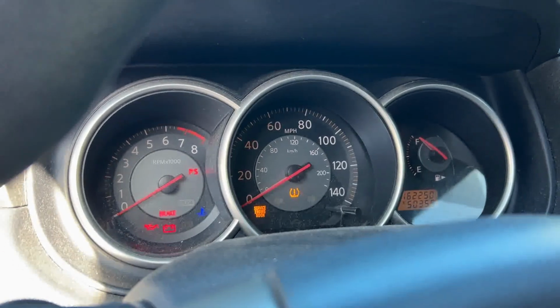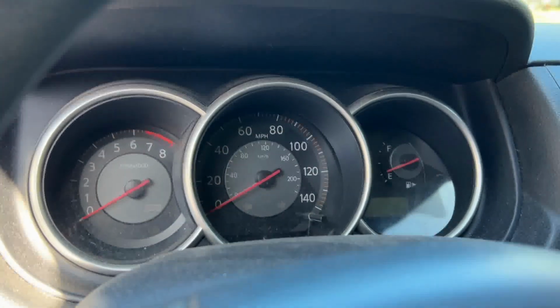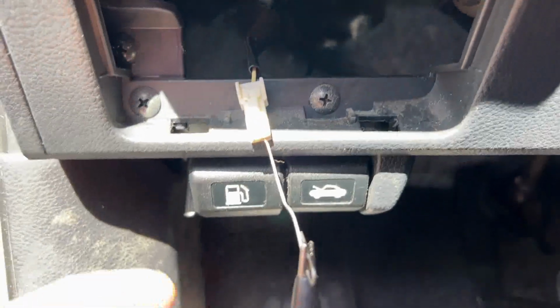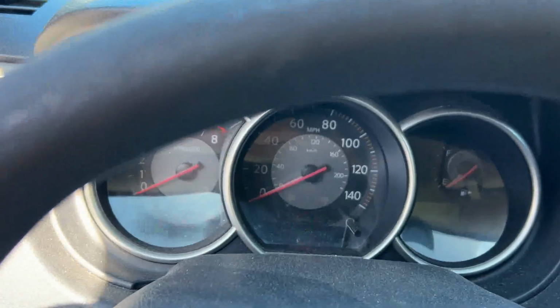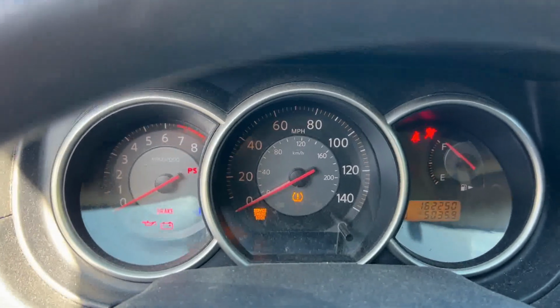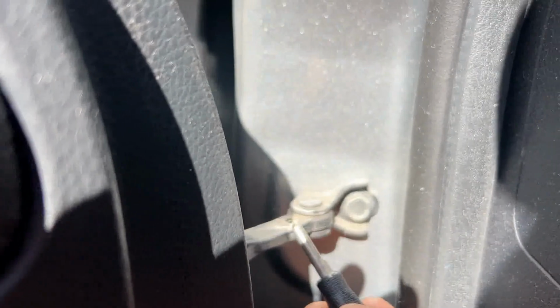So I'm gonna turn off the key so that I'm not gonna get an electric shock, and I was working on that. So I actually cut the electric tape, and now you can extend the cable to here, and I put the paper clip, and I'm planning to short circuit there six times. It looks like the magic number, so I'll try that. So turn on the key, and I'm gonna wait about, I think it said 1 minute, that's gonna blink, and I'm gonna wait for that to go into the steady on. Okay, now the light is steady on, so I'm gonna try to short circuit 6 times in 10 seconds.